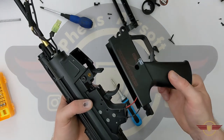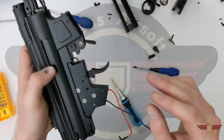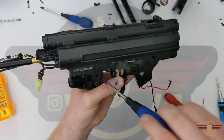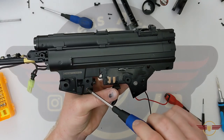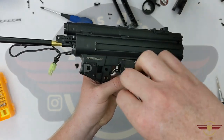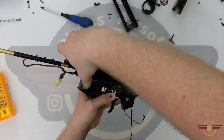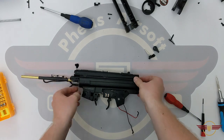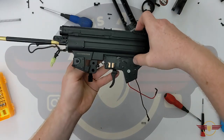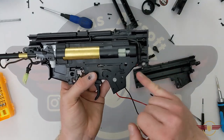Just feeding the motor wires. At this point we've got another screw here - I've removed one at the top, the mag release, and one from the front. There's one more here and then the body will split in two coming up towards me. It's just a case of getting your thumbs in between it all and lifting it up. There's a pin in there - there we go.